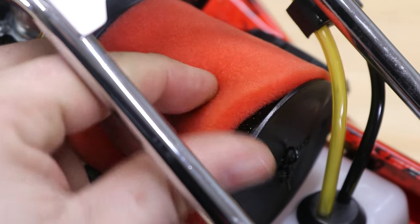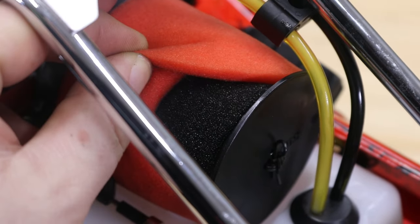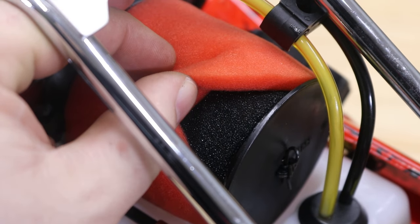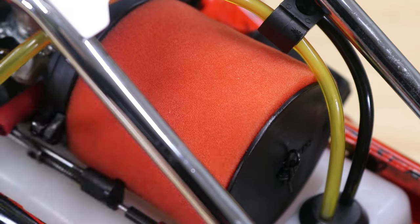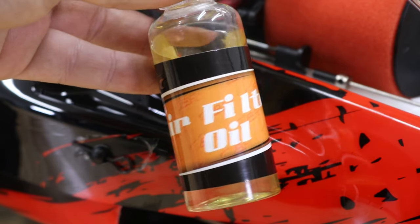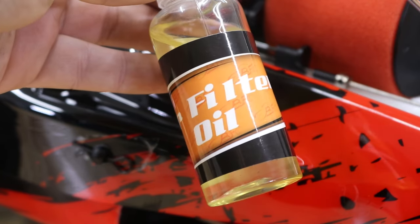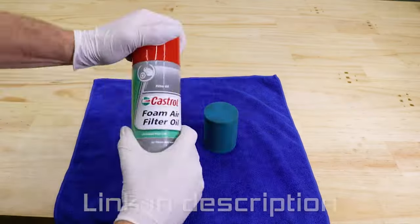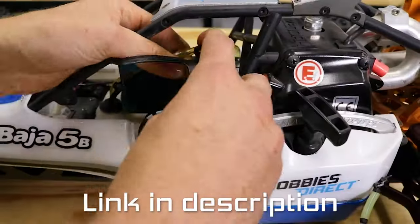Check to make sure the air filter is oiled from the factory. Do this by sliding the outer foam back and inspecting the inner foam filter. If the inner foam air filter needs to be oiled, do so before use. You can use either the included Roven foam air filter oil or another high quality spray oil like Penrite or Castrol. We've done another video on how to do this step by step — see the link in the description.